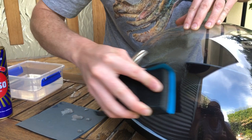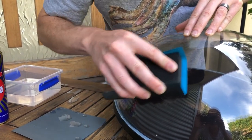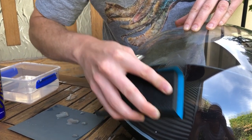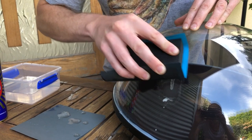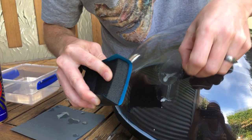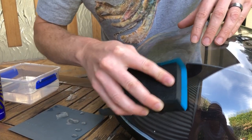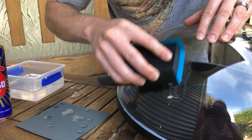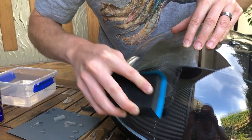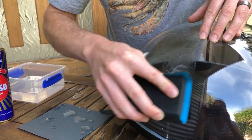I just want to move around quite locally there. It's going to look a lot worse before it gets better, so you just need to be brave. I can almost see straight away that the scratch is nearly gone. Just use your fingernail to rub over where the scratch was to check — I can still feel it a bit. Just keep the paper nice and moist. I'm pretty sure that scratch is starting to go now.